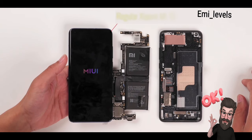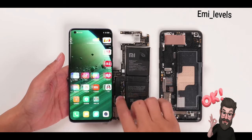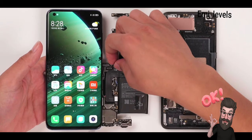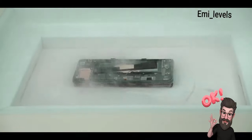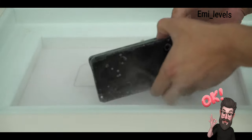We placed the screen of the regular Xiaomi 10 onto the Ultra model and performed a boot test. Display and touch worked fine, but it may not support the 120Hz screen refresh rate. For display teardown this time, we tried something different — open the freezer, put the display inside at minus 180 degrees, and set a 3-minute timer. Upon opening, the middle frame, inner display, and outer display separated all at once.